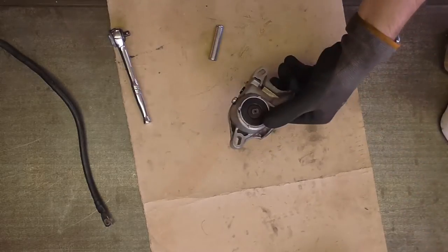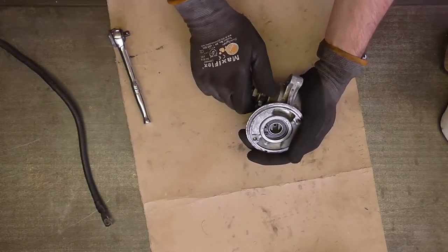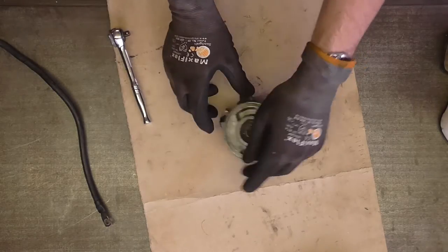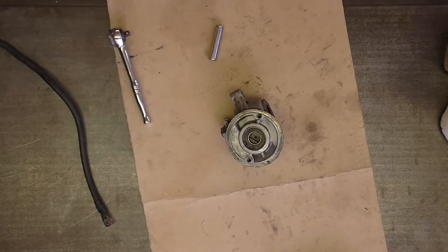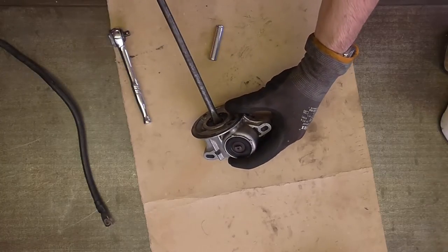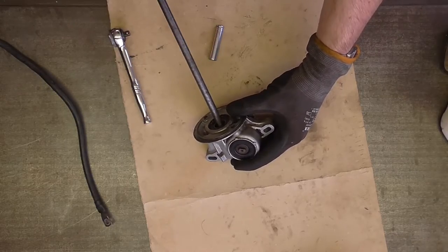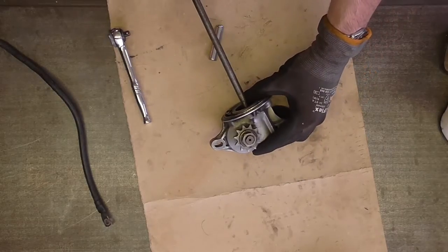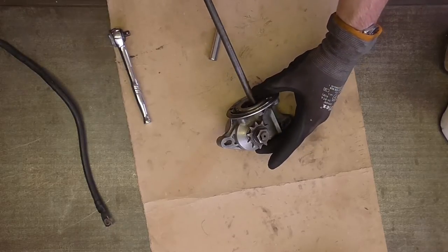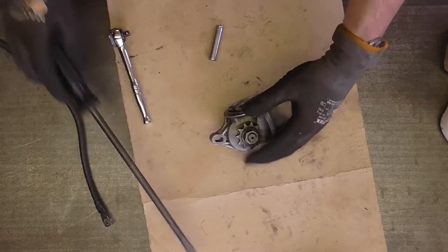I have a horrible feeling... oh, that's completely gone. That's actually skipped a tooth - yeah, that's why the extra movement is there. It's shredded a tooth, that's gone. Yeah, just turn it with the big screwdriver. That's completely gone. I suspect it's worn and then you've just worn through at one point and it's jammed - so it's working most of the way round and then getting to the bad bit.